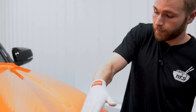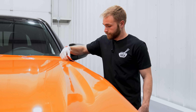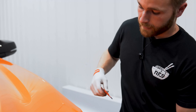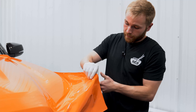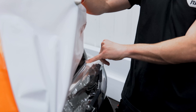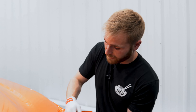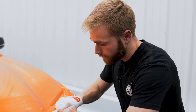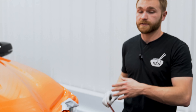As you can see, it pushed that entire recess cold without any heat. We can go back and make sure we get the opposing side of that recess, and card back and forth all the way up to your fender edge. With this specific hood there is one more body line past here, so we want to pick this up to release it from the headlight. We're going to use the same technique for that corner to get adequate stretch, and that will help this edge and corner wrap significantly better than if you just laid that cold with no stretch. Now that hood is completely laid on this side — we're going to repeat the process on the opposing side, and then we will start our trim work.